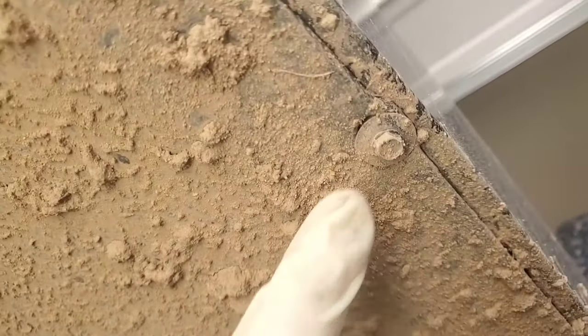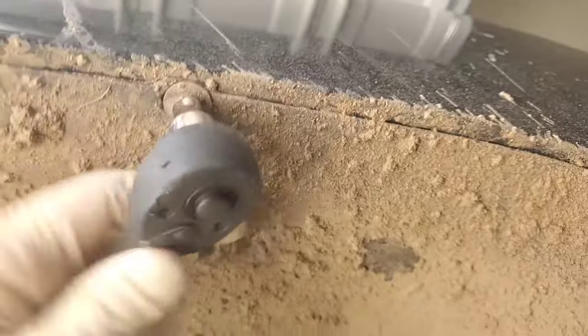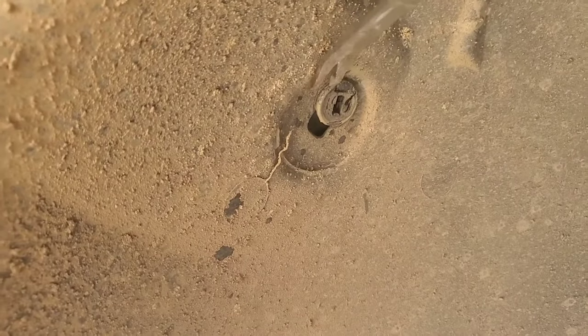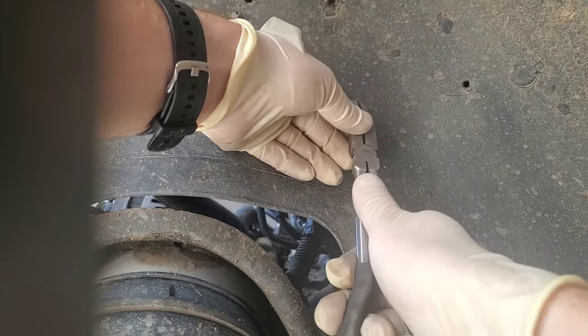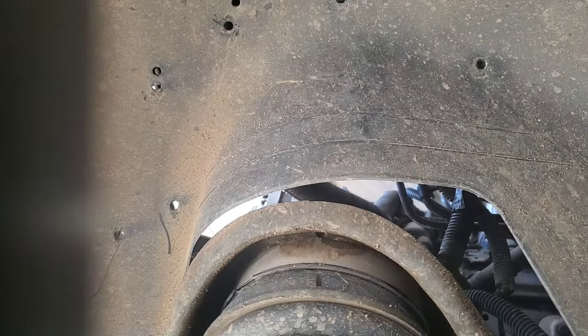There's a few clips in here, and you've got some small 7mm bolts, plus a bunch of wire harnesses clipped through here. Start removing all that stuff — 7mm up here, I think there are about 3 to 5 of them. There's a 10mm up at the front of the wheel well. These little guys you just pop the center out. Harder to do with one hand than two — I should have used a tripod. With these, you just grab them with pliers and push them through the inner fender well, or go from the other side and pull them straight through. Whichever you prefer, no wrong answer. Just make sure you get all the connectors out.